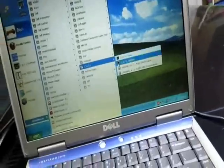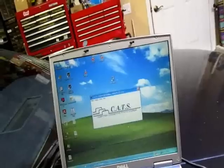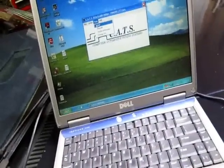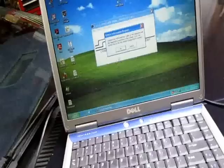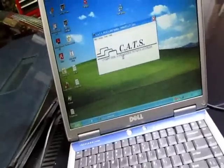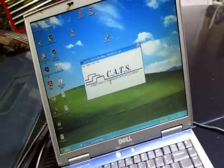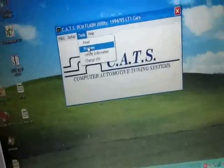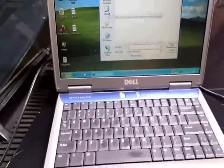I'll be using Cat's WinFlash. Select that, go to Tools — I'm still new at this — see Read. You want Vehicle Information. Go to Vehicle Information to see if we can get the VIN, then you know you're connected good with the cable. Yeah, we got it. You can change the VIN on the PCM if you want, but what we're going to do is just program it. We don't care about the old program because it sucks — we got a different tune.